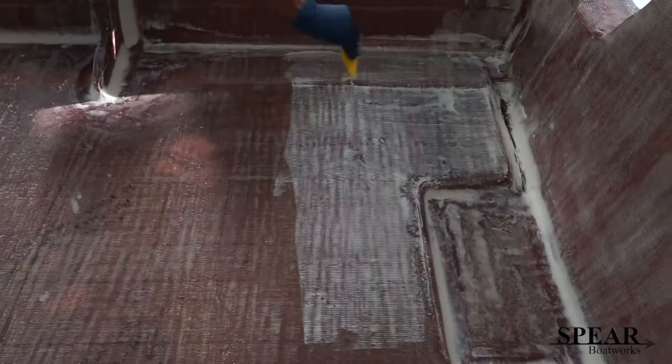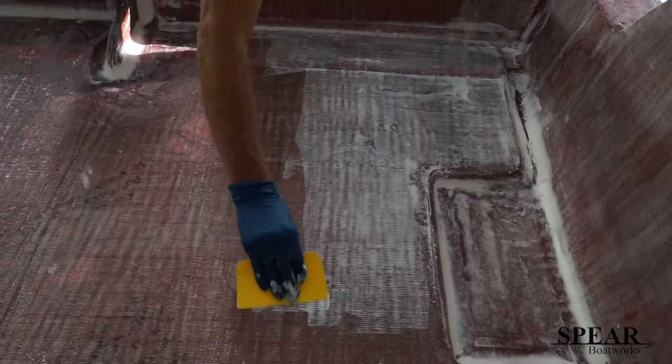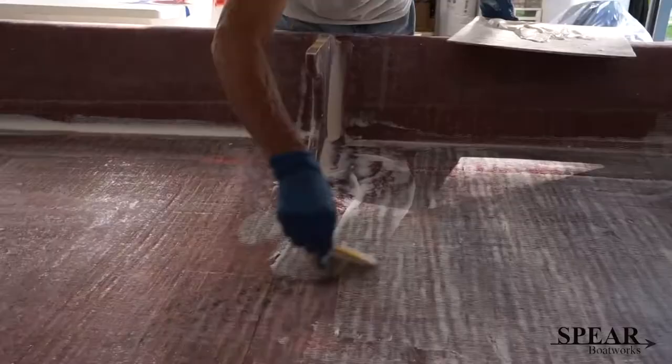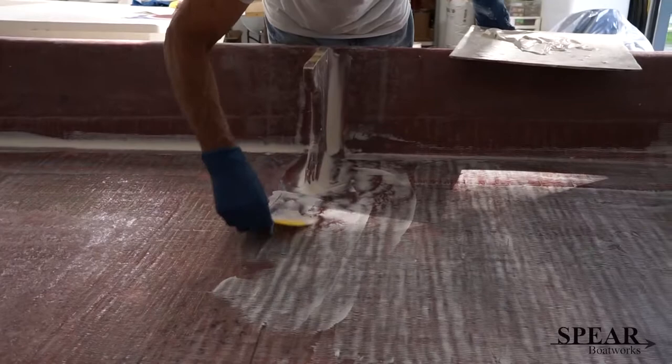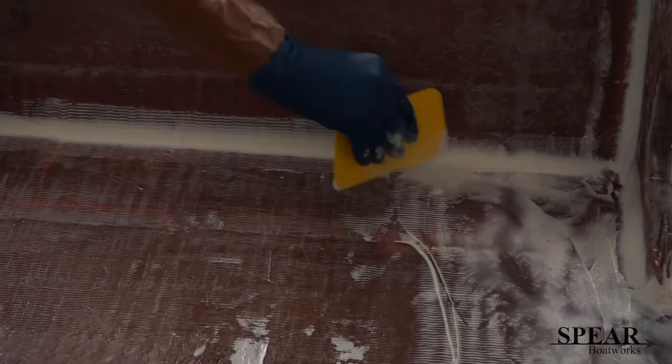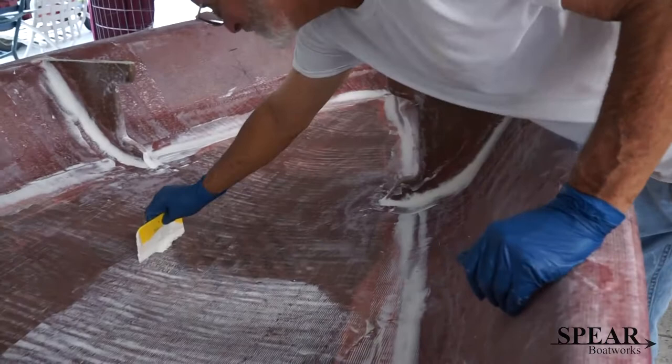It's already firing off. I'm picking off little boogers of it. Starting to get the floor. I try to get all those rough edges off because everything that you leave sticking up, you've got to sand off. So whatever you can do with your tools to make it smooth, do it. Take your time. Don't mix up giant piles of putty — I've got probably a cup and a half here. If you mix up too much, it'll fire off before you get it applied, and then you're wasting your money and you have to clean everything up.